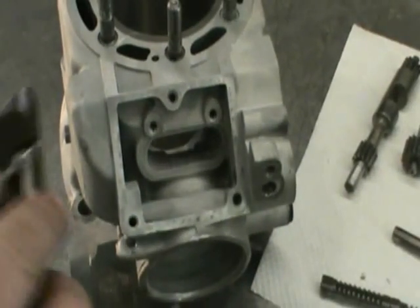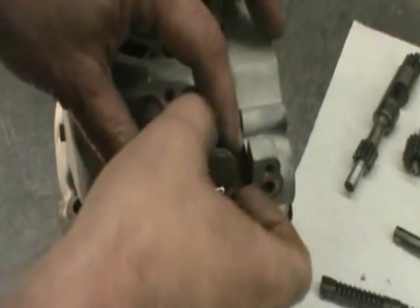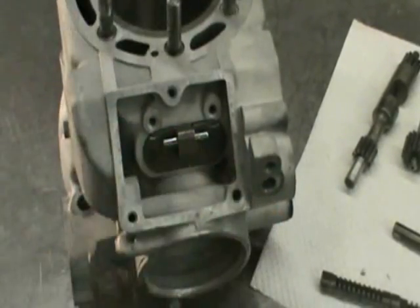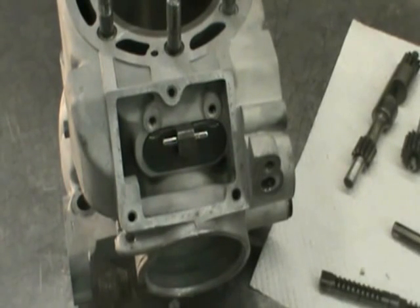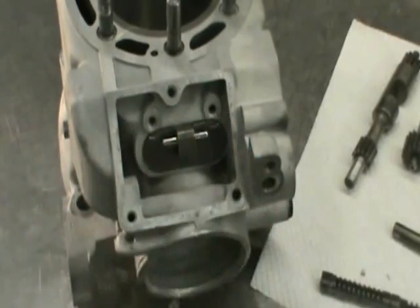The first step here is going to be very difficult — you just get this valve in, just drop it in, push that in. The next step, you take some Loctite 243, just blue Loctite, and we're going to put a little bit in these threads.